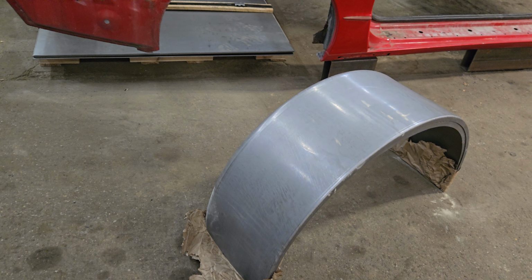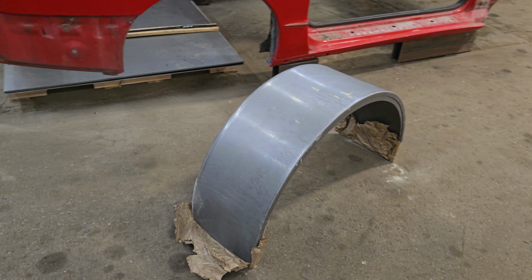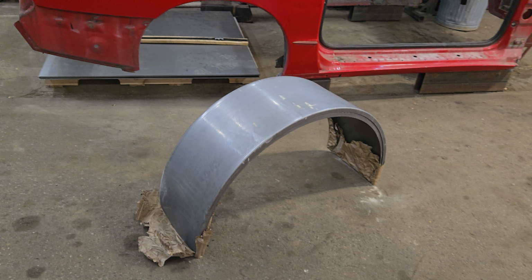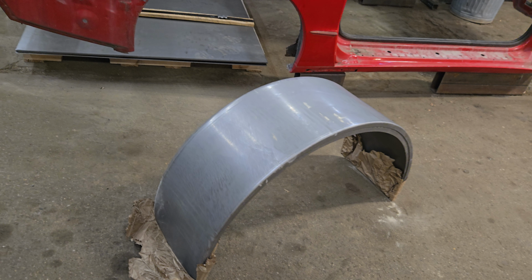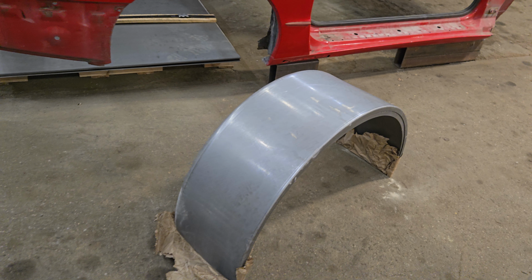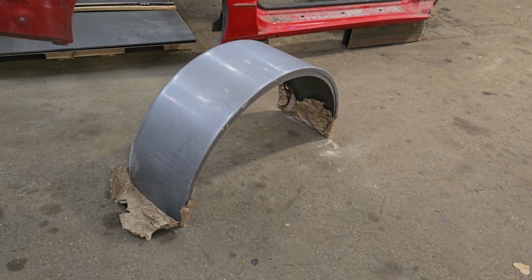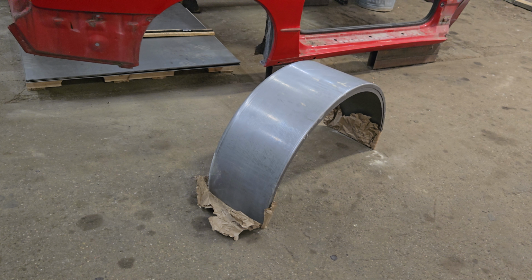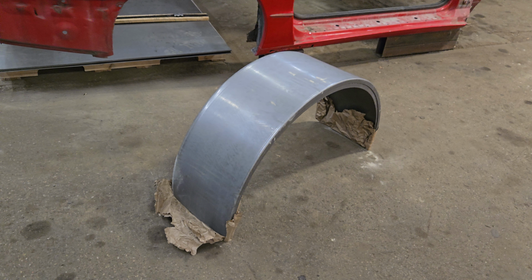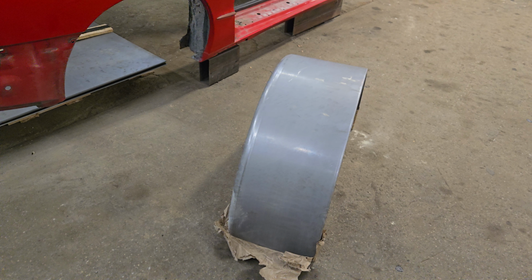So I always try to think of ways around complicated things where, great, if you've got the money, spend the $700 to $1,000 and get some professionally made wheelhouses exactly to the size that you want. But if you're not a pro builder, $750 for a set of wheel wells is pretty damn expensive. But you can go to Northern Hydraulics or eBay or Jegs or whatever and buy these trailer fenders for $100 a piece and then widen them out to the width that you need.